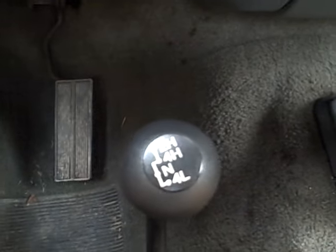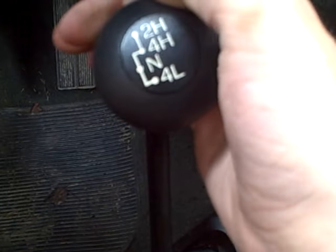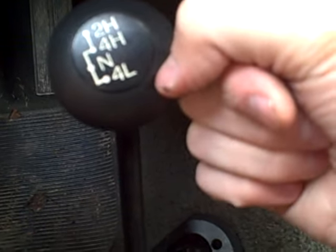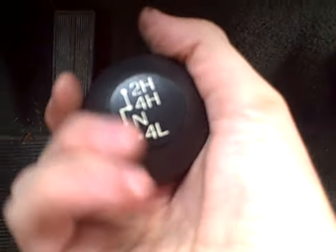So in summary: first thing you do to use four-wheel drive in your truck — you go outside and lock the hubs, put them in lock. You come inside your cab, take it from two high, put it in four high if you want to go fast or it's regular driving. Then neutral, and then four low. You choose either one. Four high is full-speed four-wheel drive. Four low is low-speed four-wheel drive — that's only for deep snow. Four high is what you want in regular snow. And two high is what you want in just regular highway driving.